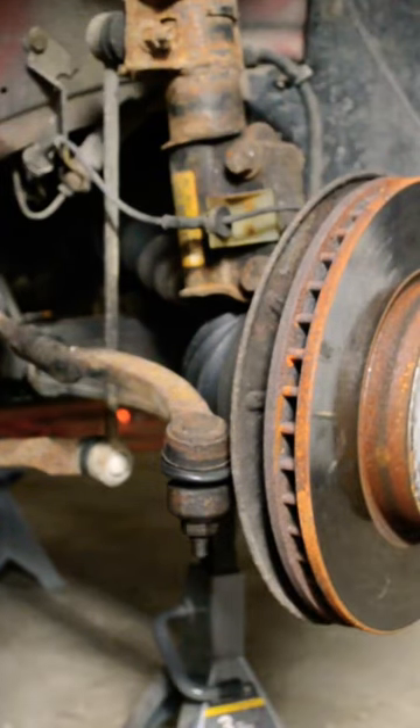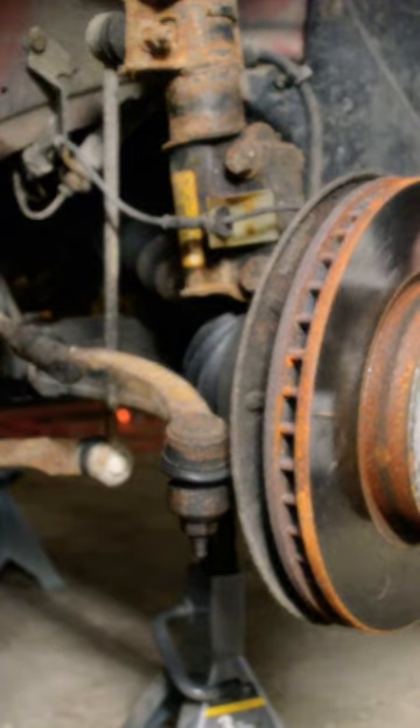End links will make noise with a surface change, like pulling into a driveway or a parking lot, and they can be difficult to diagnose because when the car's up on a jack, you can't repeat the noise.